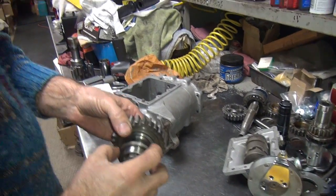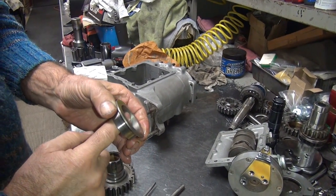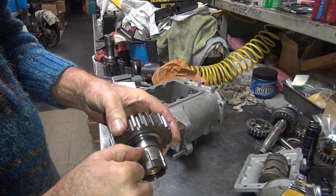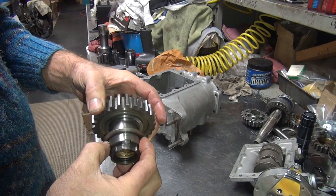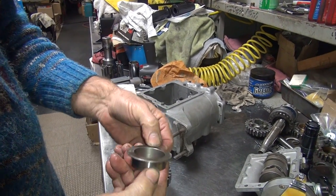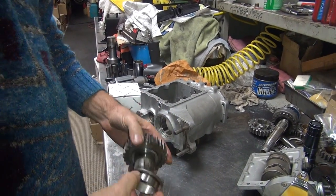That's stupid. Another guy, he was putting the O-ring a little bit further in here. But what are you going to sit on? These aren't machined for a seal. So what's that going to do? That's, at best, marginal. But at least it'll tighten up a little bit, but not very much, because it's just going to collapse. It's just going to crush this tight if you tighten that nut down like you're supposed to. So that one doesn't work.